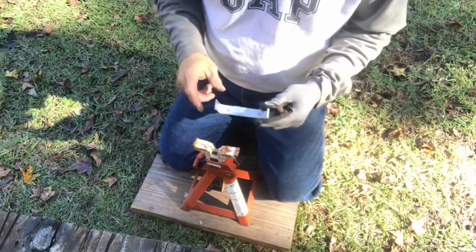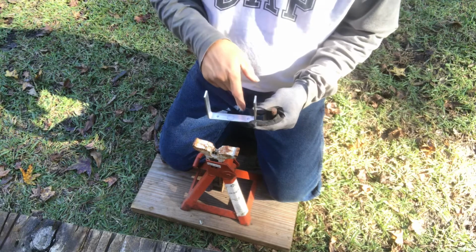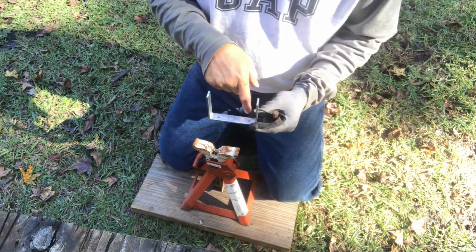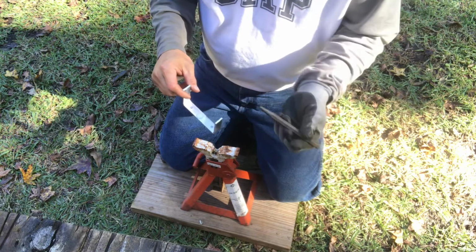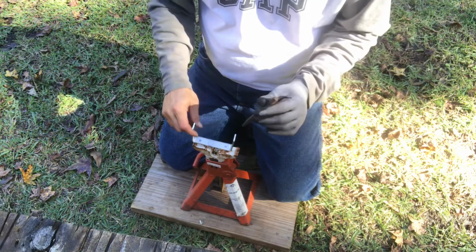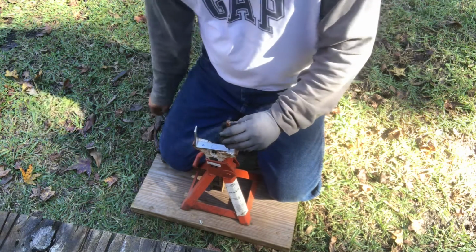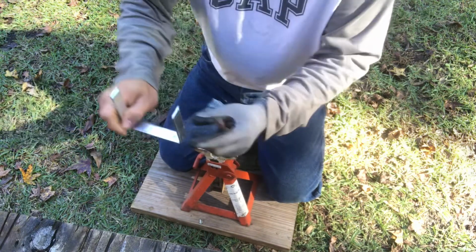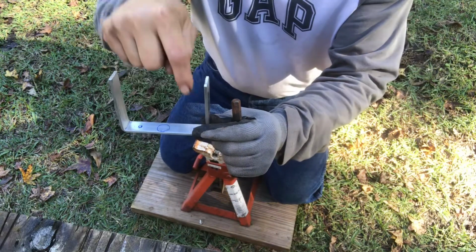Before you drill, make sure that you drill at the center of the hole. You don't want the drill bit walking. To do it correctly, I have here the thing called an awl. I call it an awl. I don't know what you call it. You put it on there. It's just like a pincher, okay? You put it on and you pinch the mark right there. There you go. You see, it's dipped in. That's where you put the drill bit in, and it just drills onto that hole.